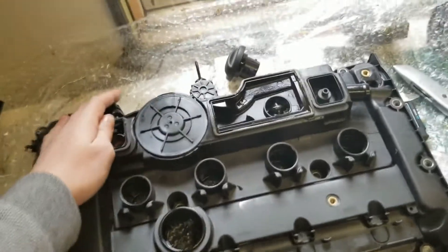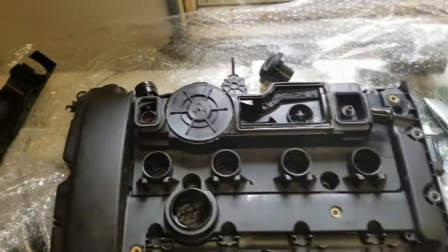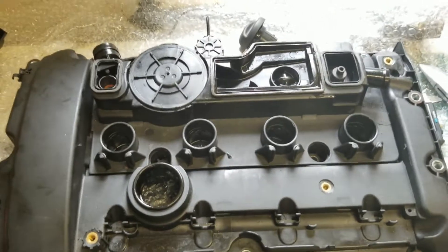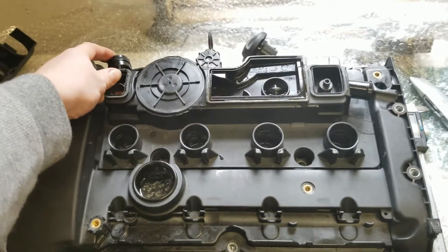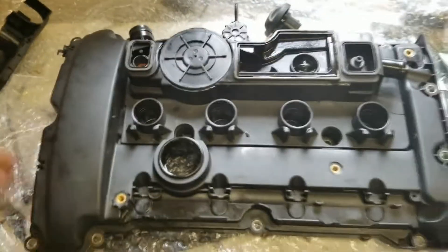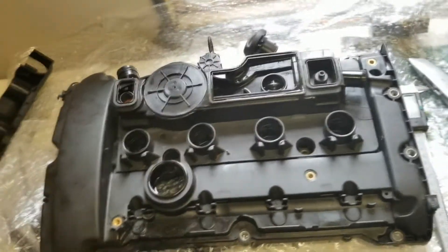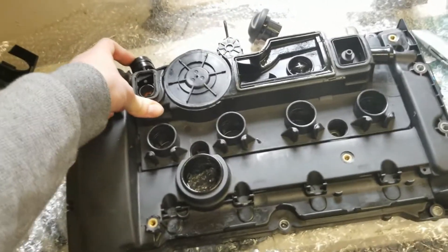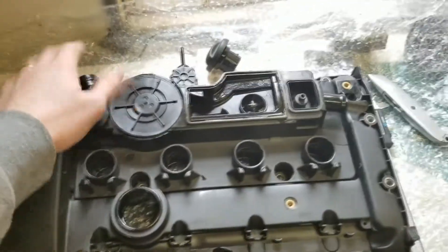I don't think it's the end of the world to block these ones off — you're still going to get some airflow through there. But they put both routes in for a reason, so it's probably a good idea to keep both running, and that's what I'm going to do. I did experiment for a while with having an oil catch can on this one, because unless you're driving quite hard, usually the turbo is not spooled up enough to create negative pressure — this one's open a lot of the time, especially when you're cruising. I put an oil catch can on this side and it worked all right. It does of course mean you've got more points for air leaks. Because I was having issues with the PCV system and air leaks, I took mine off — but maybe after I've sorted all this out and it works properly, I might put an oil catch can back on there.